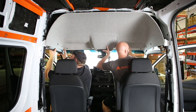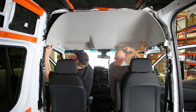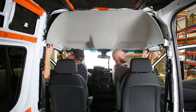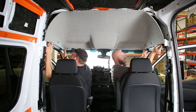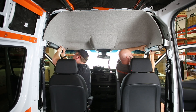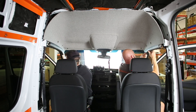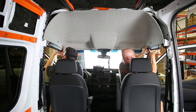On each side, you'll know you're lined up when you can see the factory holes for your visor on both sides through the holes here. Then you can take your airbag piece and push it behind the headliner. There's a gap where the headliner came out of before — that's where you want that bottom side edge of the headliner to sit in. Then you want the metal brackets behind the airbag piece to click back into the place they came from. It takes a little bit of massaging, but once you get it in there it should be relatively easy after you seat the headliner in that tray.